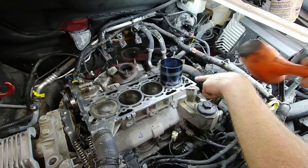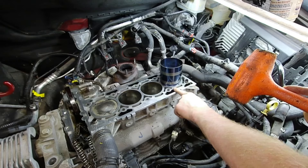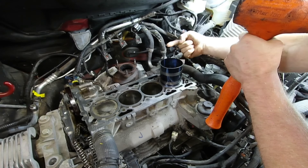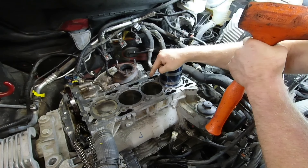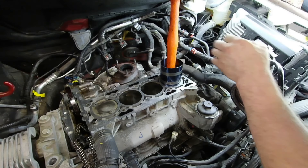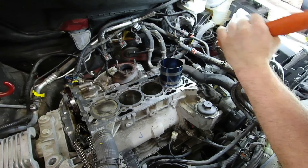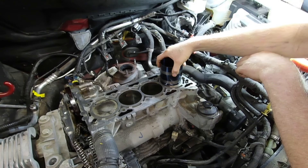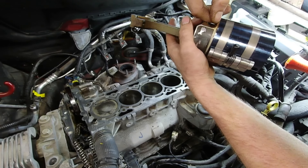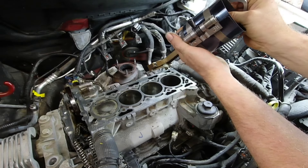Now, remember I said the ring compressor was on crooked. What you need to do is take a light rubber hammer and just work it until it's bottomed out against the deck of the block. Make sure the arrow is pointing towards the front and try to make it as square as possible. I'm going to lightly tap on the top to get it started. This one stopped — that's not good. It may have been because it was so crooked that it didn't seat tight enough. Pulling it up to look, there's an oil ring starting to pop out. You always want to be very careful — those oil rings are very easy to damage. I'm going to reset this and square it up a little better before tightening it down.